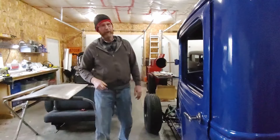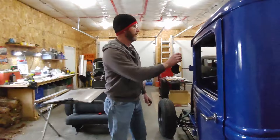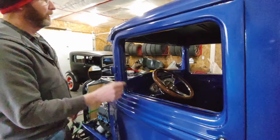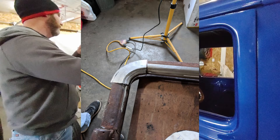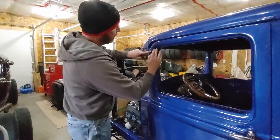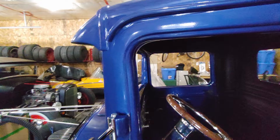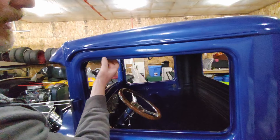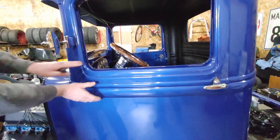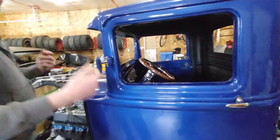Once I had the door skin made and put on, there were a lot of different pieces on the door skin itself that had to be repaired. Even this rail here had to have a couple of repairs on it, but one of them was pretty much shot completely. I took a piece of flat metal, bead rolled this edge, and basically hammered the edge down, and that made my repair for that section. I also had to make pieces to go across the top here because the metal was just basically shot. Luckily, the belt line was in pretty good condition on the doors. But just work at it piece by piece — that's how we reconstructed the doors.